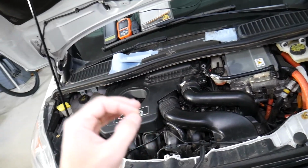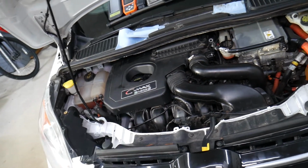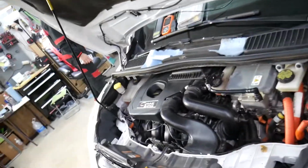Those oxygen sensors have heaters when you first start the engine. Those heaters will warm them up so they can start reading almost immediately, because the later they start, the more you pollute, the more fuel the car uses, and all that stuff.